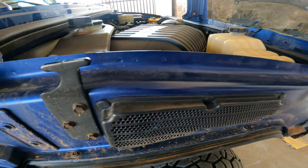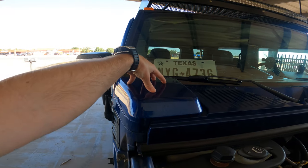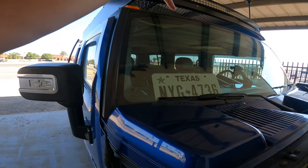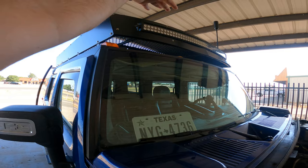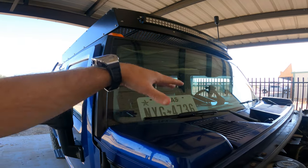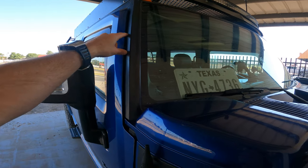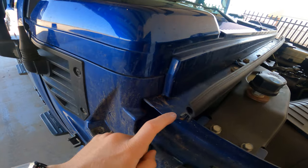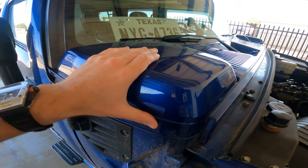I think our whole system should flow a little bit better. The plan is to cut this top cap piece right here, and we'll have our snorkel maybe about a foot high - not super high like some people, just about a foot up. I think we'll also run a brace coming in here, and this structural piece right here might be a really good area to weld some tabs onto our intake pipe and then bolt it in, as opposed to trying to bolt it to that plastic piece. Anyway, I'm going to start pulling all of this apart and see what we're working with.